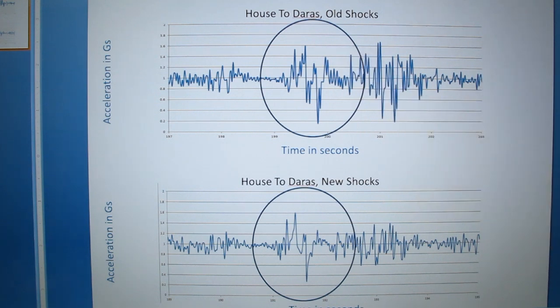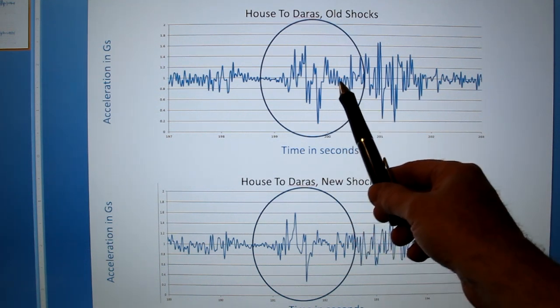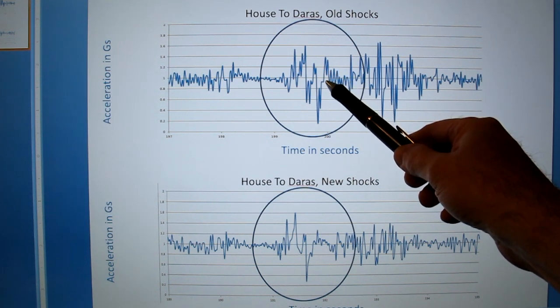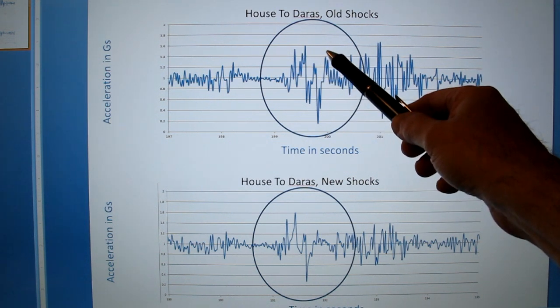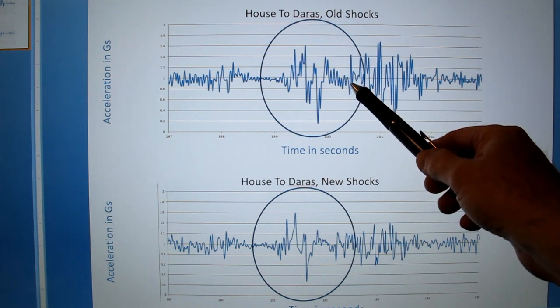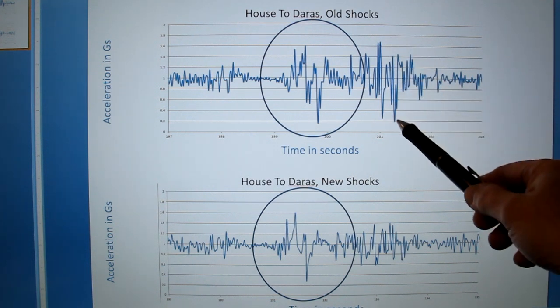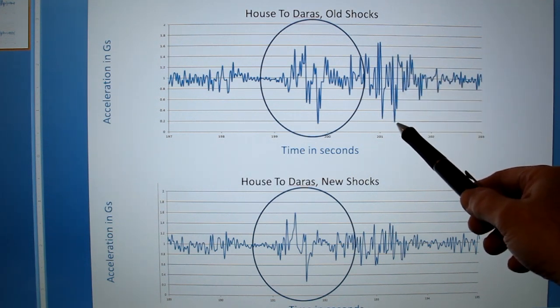And that's a fast version of what you see in most videos, or if you've ever pushed down on a car and watched it kind of bounce up and down for a car that has bad shocks. This car has high spring rate, so I think that's probably why it's so fast. This is probably what some people would call wheel hop frequency. It looks to be about 15 to 20 hertz when you look at the numbers. And here's a significant case where it hit a bump, and then it just rings like crazy. Now also, after this, there are some sections where it's just ringing a lot, and here's a case where it's going down to 0.2 Gs.